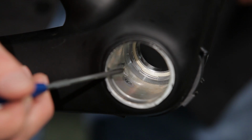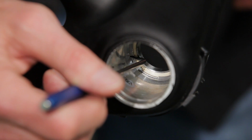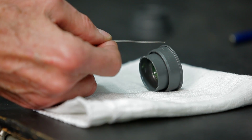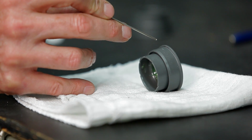Tool companies make adapters or bushings for this, or you can use a socket of the right size. Bearings are pressed in until they hit some reference point. For a BB30, they butt against a removable circlip in the bottom bracket shell. BB86 are fully installed when the raised lip on the adapter contacts the face of the bottom bracket shell.